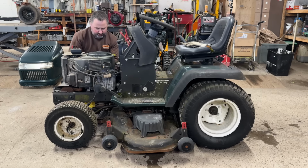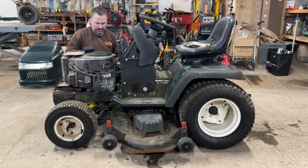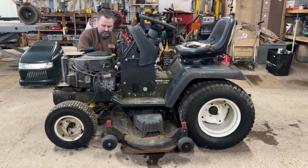Okay. Let's see if the wire to the starter is getting any power. I mean the little wire that goes to the solenoid. So there's a big wire that goes to the solenoid on this starter, and then you've got a little tiny blue wire, which I'll show in a picture. And I've got 12 volts right to the starter. So unfortunately, this really expensive starter is no good. Okay, I probably have a used one.